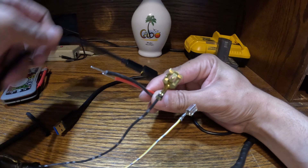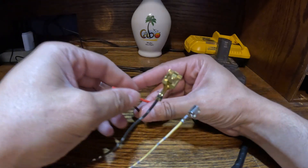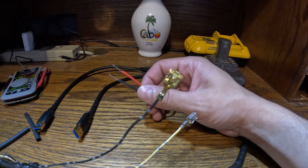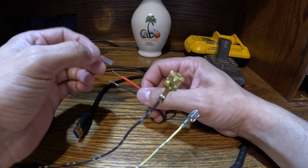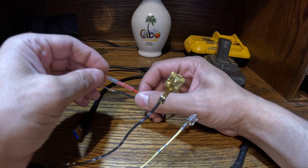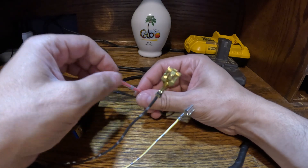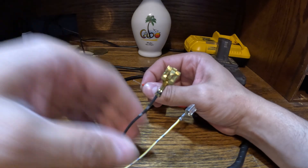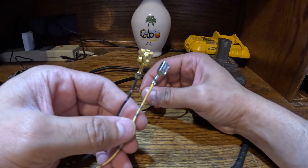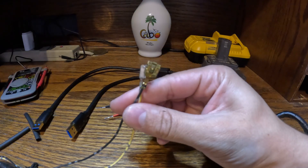It's got a little lid. Unfortunately it is mislabeled as 12 volts on here, because even the 2008s and 2009s came with a 12-volt cigarette-style power port instead of USB. This was just my solution — I'm trying to figure out how to get some power to the center console. I've got little solder seals here; these things are great and you can find them online on Amazon.